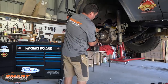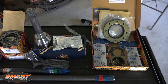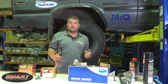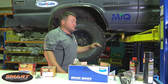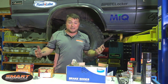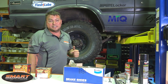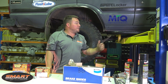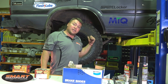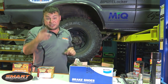A few weeks ago we totally stripped down the front axle and did a full rebuild on it — half shafts, CVs, new wheel bearings, and it also had the AVM hubs on there. While it was up on a hoist we had a look at the rear drivetrain. It was all good apart from the rear wheel bearings, just a little bit of play there. We could have just nipped them up but because of the k's this truck does we thought it'd be better to change them out so the front and rear wheel bearings were changed at roughly the same time. And while we were looking at the passenger side we found an even deeper problem with the brake shoes, but I'll show you that later.